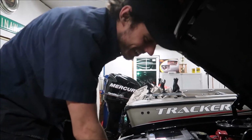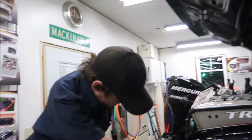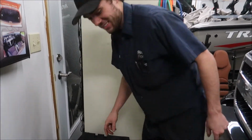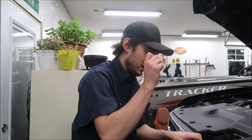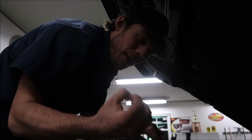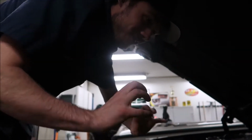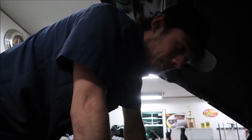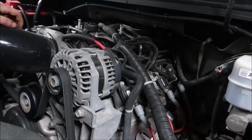Putting a rocker trunion kit in. What does that do? It's basically because LSs have, on the back of your rockers, a captured needle bearing on the rocker pivot. And with aftermarket cams, they can tend to spit those out because they're press fit in there. They're held in by friction, but with a lot of spring pressure, they can pop the caps off and put needle bearings in your motor, which is no bueno.